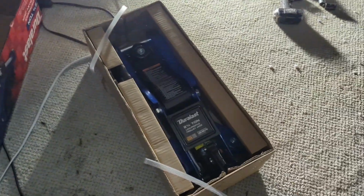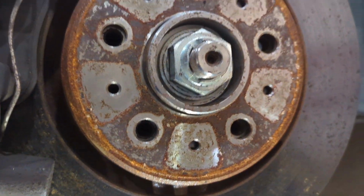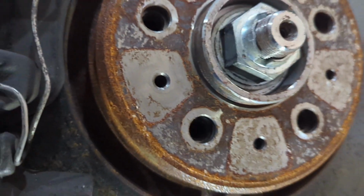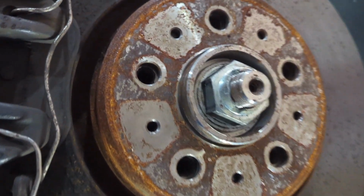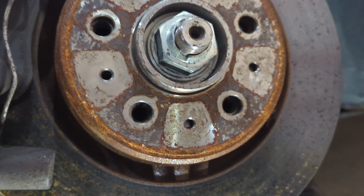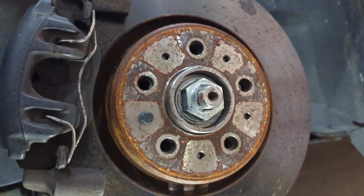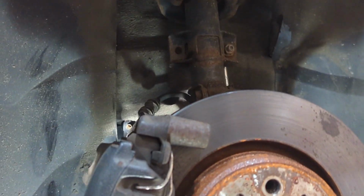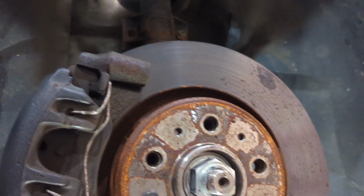Abracadabra, and there we have it, folks, a floor jack. Let's get this ball rolling. Done with the control arm, but last but not least, this rotor is missing the holding pin, so it spins around on the hub, making it hard for you to put the tire back on. I got a screw I'm gonna put in there to hold that in place. That'll do it, and the wheel will fit over it, so it won't be hard to put the wheel on after you're replacing a tire or something. And this thing's got 302s on it, big brake kit.